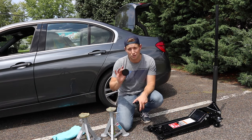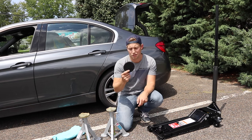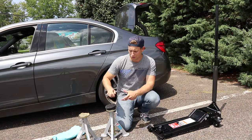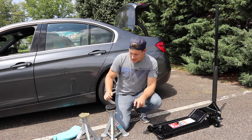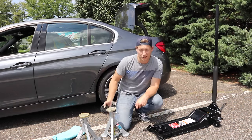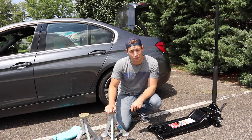If you're going to jack up a car that doesn't have jack adapters, or maybe you're just going to jack your BMW up without them, it has these really thick, really nice rubber stoppers that go on top here. Once you put a little weight on it, they sink down — they won't stick up all goofy like that. These are definitely a must-have if this is something you're going to be doing.